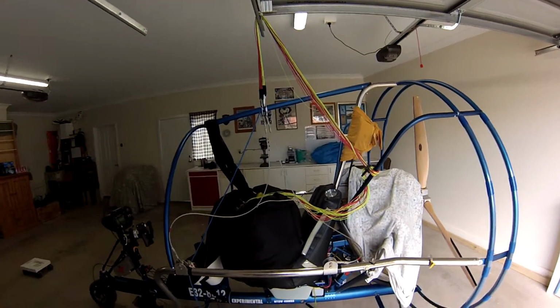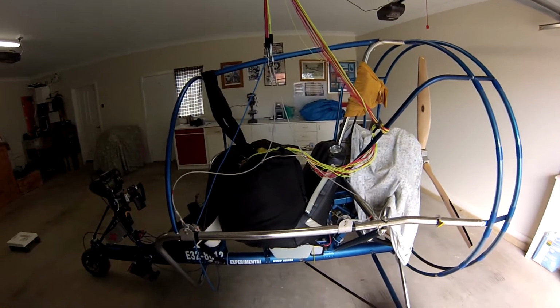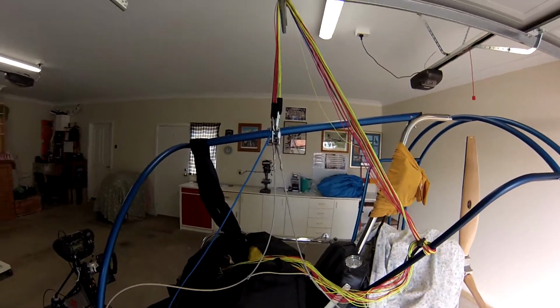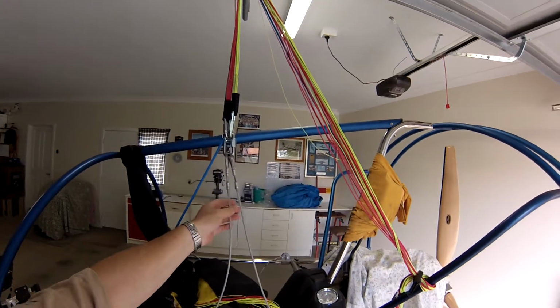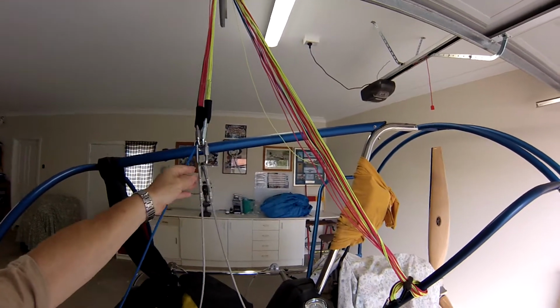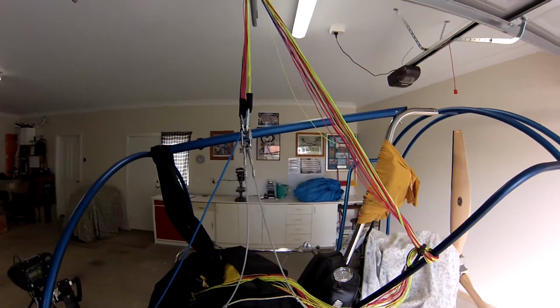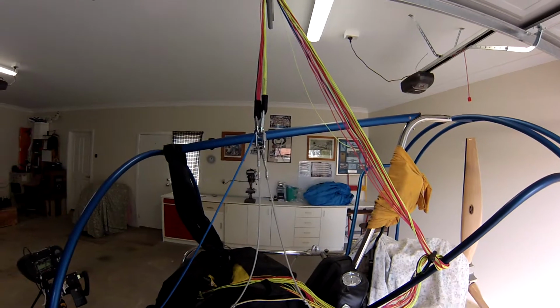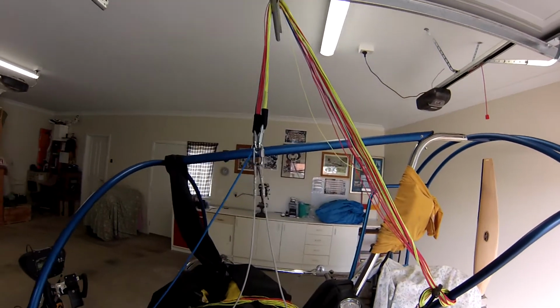Okay, here we have the Summit 2-seat with the 582 motor in it, and my Summit has a Thunderbolt E340 elliptical chute, which does have a tendency to turn left a little bit. I think most of the chutes do when we're at higher power settings. So this is what I've done to offset it.